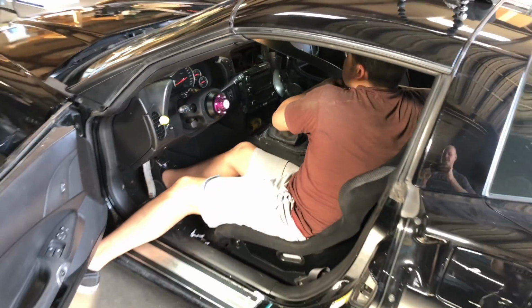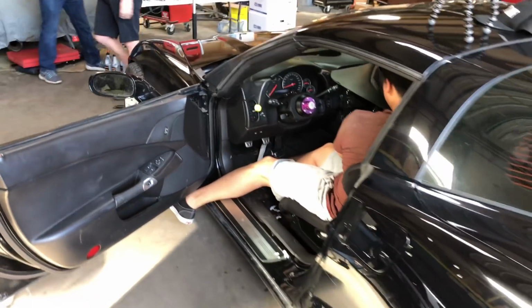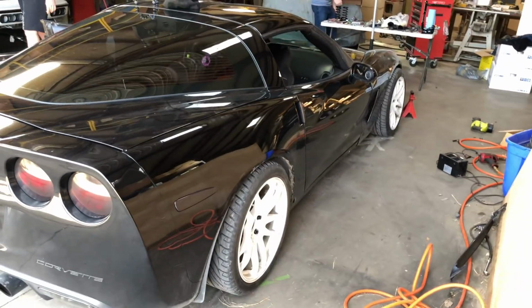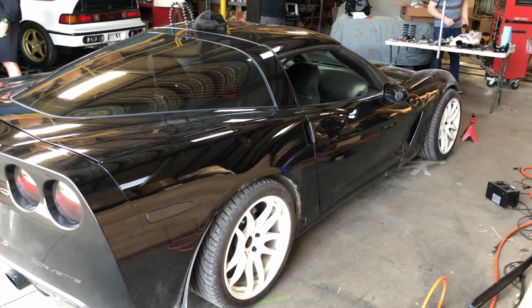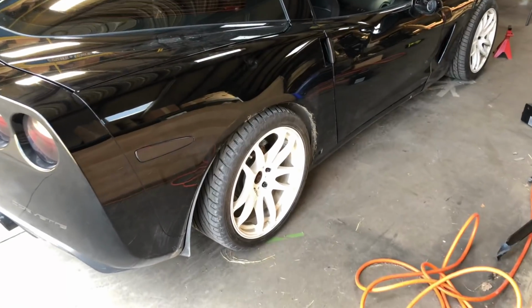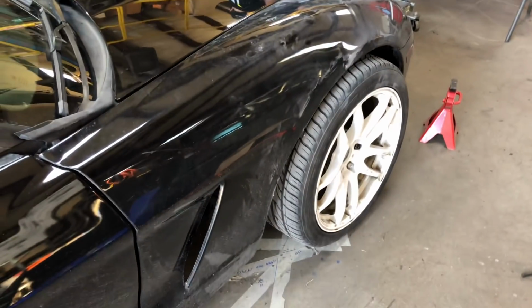He is currently taking the, oh, it's day 2. This is the first shot of day 2. Marco just installed coilovers. I'm slacking on the filming side. So now the car is on coilovers. The ride height is pretty well adjusted. We still have to do toe. The rear has been dropped a little bit. The front has been dropped a bit. The front has been cut last night.